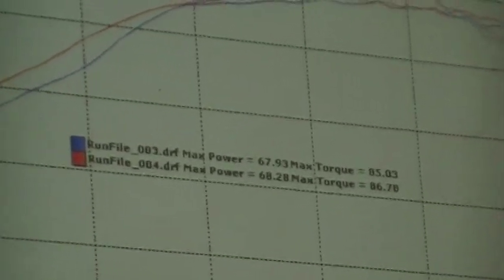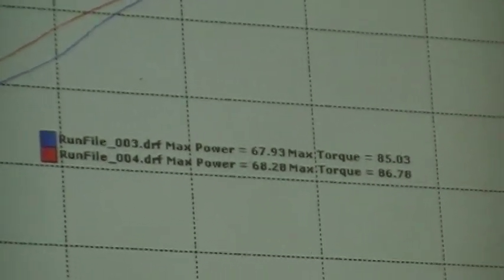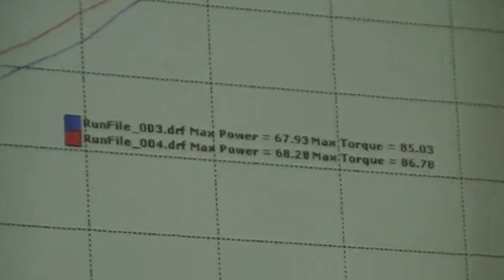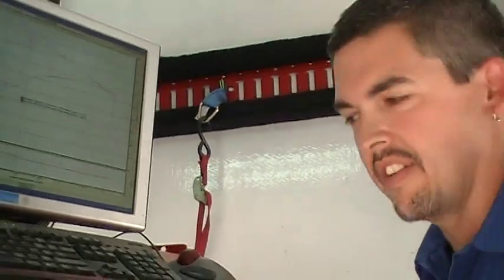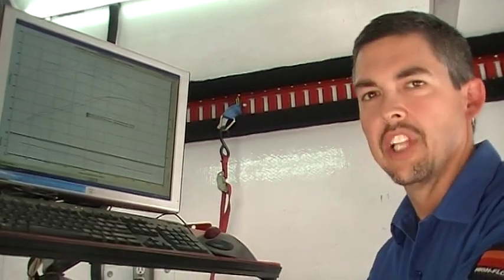The explanation I've been told about these plugs is because of the way they fire and the directness that they fire — the teeny-weeny little tip — they're about 2.5 to 3 degrees faster on crank rotation. So when the crank spins and it tells it to fire, it's an instant fire, instead of waiting and then jumping the gap going from point A to wherever it lands.